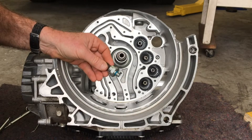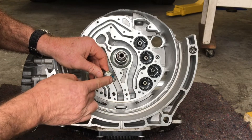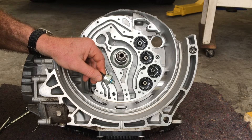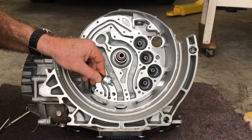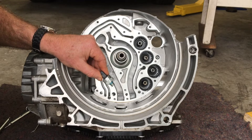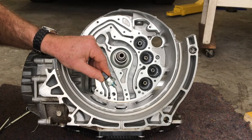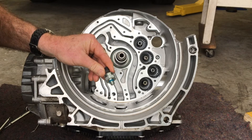The two pressure sensors used for the clutches — I'll put the part numbers up on screen in a moment — but after some research it appears these are exactly the same part as used on the newer ZF 9-speed auto, the 9HP48. It's also licensed to Chrysler who make another version using the same sensors with a different part number. If you search for 'ZF 9HP48 dog clutch pressure transducer' you'll find them, and they're not expensive — maybe around 50 bucks or so.